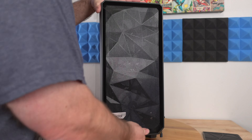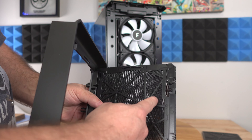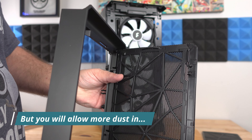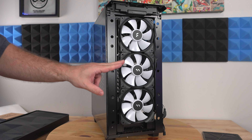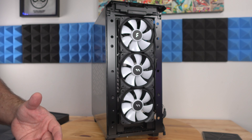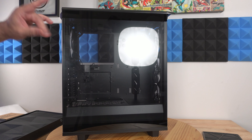You can easily remove the front panel. Removing the front panel allows you to access the front filter — if you want to remove it, you'll get a little more airflow inside the case with just the mesh design. Removing the front panel also gives you access to the three 120-millimeter ARGB fans. If you wanted to replace those fans with a liquid cooling unit you could, with up to a 360-millimeter liquid cooling unit fitting up front.